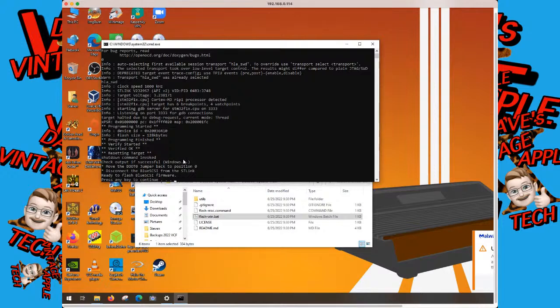But before you get up and move back, these are too many instructions. I can't remember all of them. So put the jumper back. Unplug the blue SCSI from the ST link cable. The jumpers are piggybacking each other in the same position, next to the 0. Now take the other jumper and move it, the jumper closest to the reset pin. Wait, you told me to put the jumper back. I know, that was the jumper farthest from the reset pin. Now you need to move the jumper closest to the reset pin. Okay, you get it?